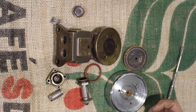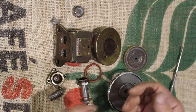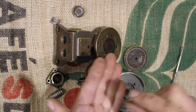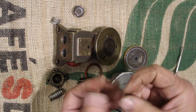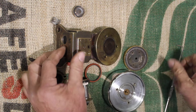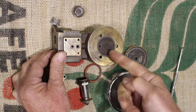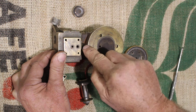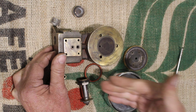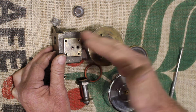It's also important to regularly clean the system with a little bit of machine cleaner in your blind basket. Put a little bit of machine cleaner in the bottom of the blind, run a little bit of water in it so it starts to dissolve, but leave enough air space so that you can build pressure with the group handle. When it applies pressure, it exhausts that coffee cleaner all the way through and into these journals, and you'll eventually see the foam flow out into the tray. It's very important that you get that machine cleaner to flow through there.